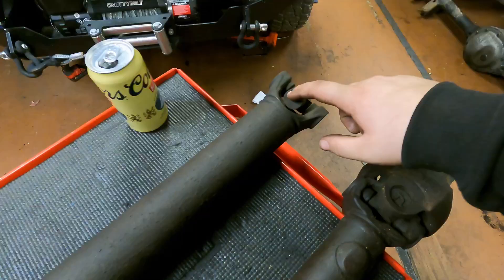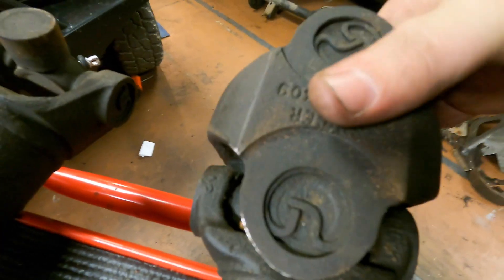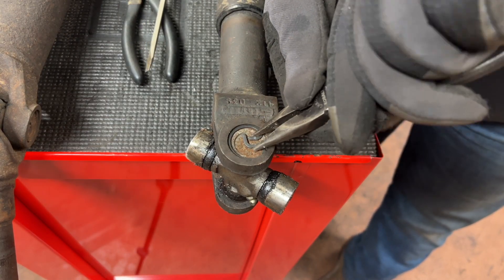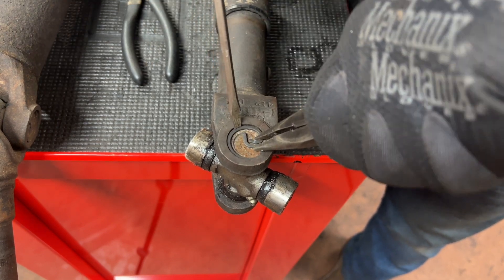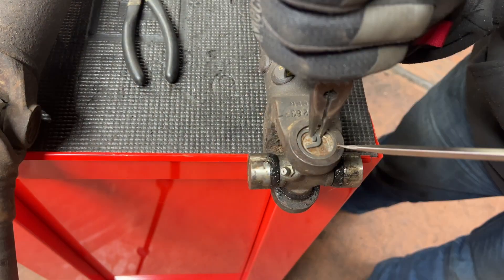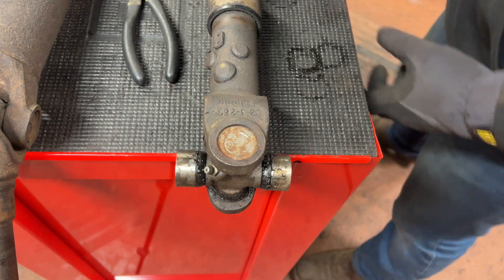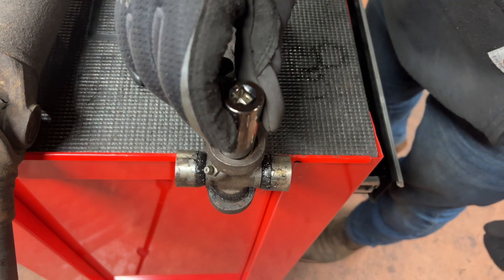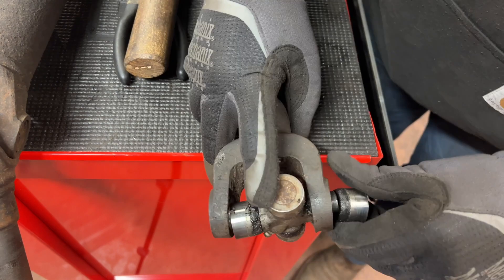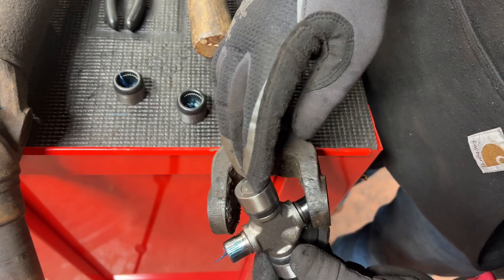Now for the drive shafts - got some new u-joints. Two for the rear drive shaft and only one for the front because of the double cardan unit, which feels a little clunky but minor detail. To get the u-joint out we have to get this retainer off - squeeze it together right here and then get under it. There are a few different ways to do the next part: we can either hammer it or use a c-clamp. I'll show you both.